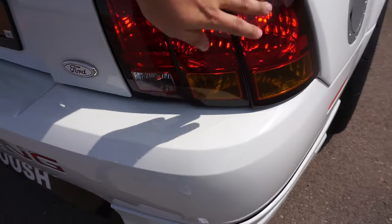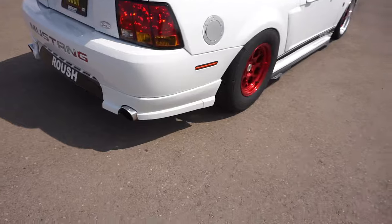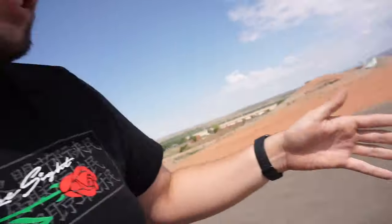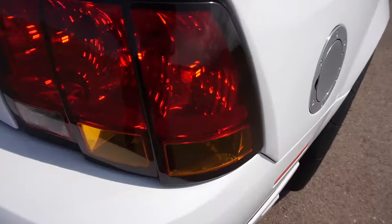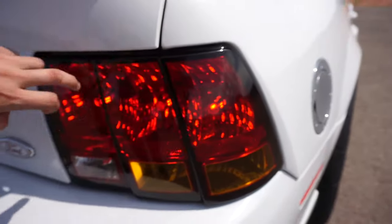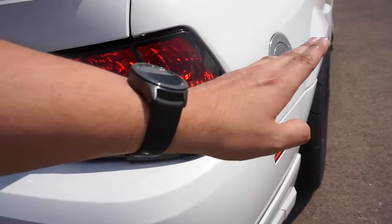Going with the taillights - these are the 99-01 amber taillights. They only came on the Cobras - these are slightly tinted. We did do a video on how to tint your taillights. I do have them paired with SW Lights LED bulbs and I also have sequential harnesses on there. We are planning on doing a video on making the amber section work with the sequential - right now only the red sections blink sequentially, but we're planning on wiring the amber from the front so both sections do the sequential.